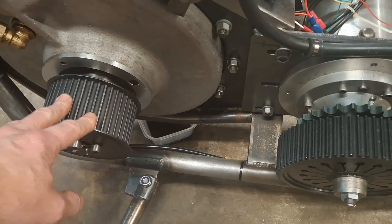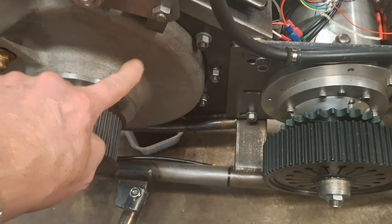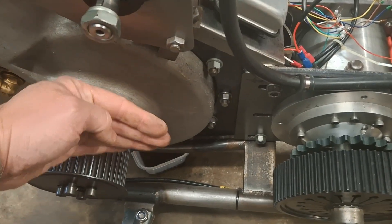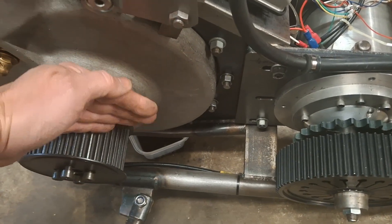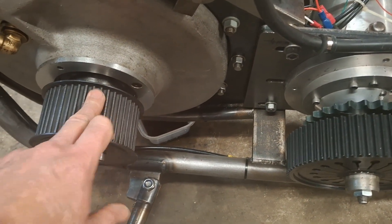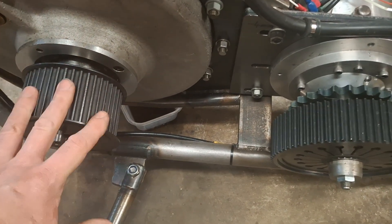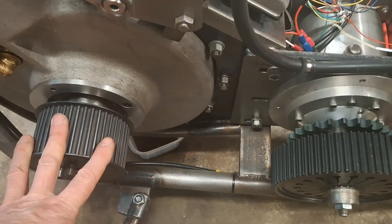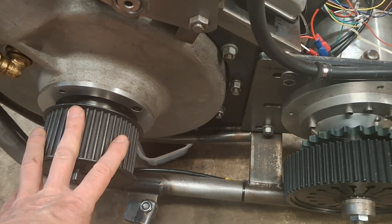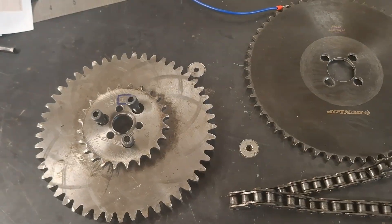There is enough clearance against the front drive pulley — or primary drive pulley as some people call it. The belt runs across here and the chain runs up here, so the two are in close proximity and there isn't a physical baffle between them, other than perhaps the flange on the end of the pulley. The belt does tend to run against this side of it, so that's not really a problem, but we just got to be careful of our clearances.